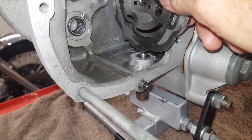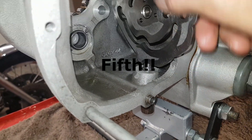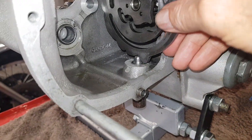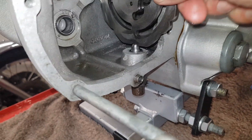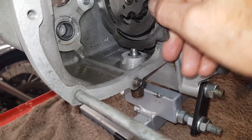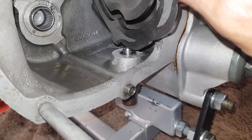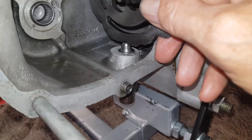Here's the cam plate. At the moment that notch is neutral. So that's first — and it won't go any further around than first. Back to neutral, second, third, fourth, fifth — and again there's another sort of lock, a locking tab there to stop it going any further. I'm just checking that it all moves around nicely from one gear to the next, which it's doing quite positively and smoothly. That's why you can probably get the idea now of why having a ball-tipped plunger gives it that little bit of a smoother action rather than just a plain steel plunger.